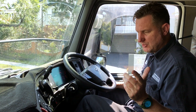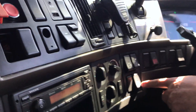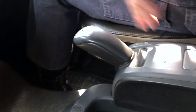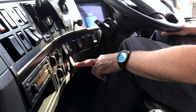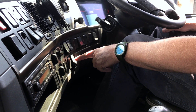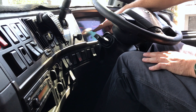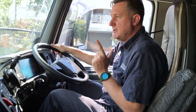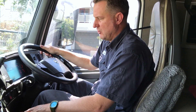I just want to explain how the hill assist works. That's the button just under here — this is hill assist. I've actually stopped the truck right now, still in automatic mode with the gears. I've got my foot on the brake so I'm not rolling anywhere. When I take off I don't roll backwards — what I can do is push this button in. The light will come on, and it'll light up on the dashboard as well to tell you that the hill assist is on. If I take my foot off the brake, the brake will remain on for a moment until I bring enough power up with the accelerator. It holds on for a couple of seconds — you can feel it actually release because my explanation took a long time and it released in the time.